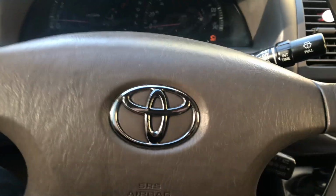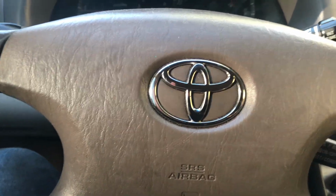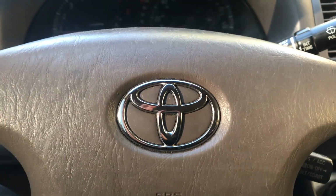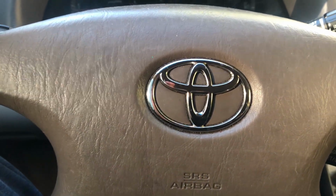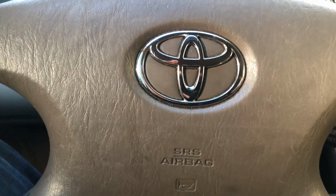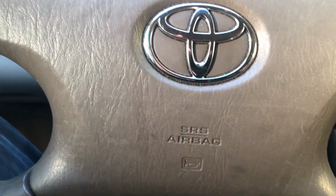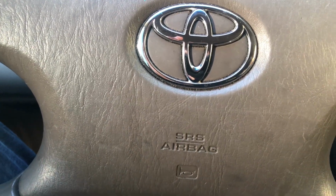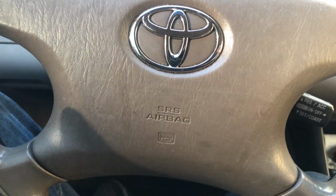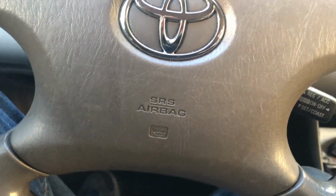So anyway, guys, we're going to go ahead and replace those parts today. Like I said, I'm not doing any diagnosis. I know the blower motor is out for sure because on most vehicles, not on all, but on most vehicles, when you put the fan on high, you get 12 volts directly from the battery that powers the blower motor. The resistor is there for when you have low or medium setting on your fan speed. Now, sometimes that's not always the case. Sometimes the battery voltage goes through the resistor in order to power your fan on high.